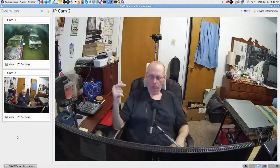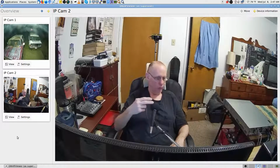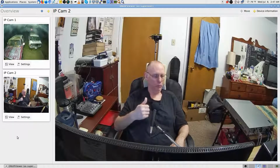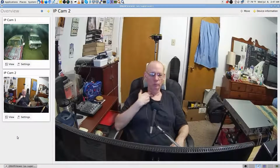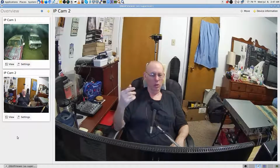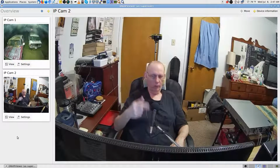But what I want to do first, I remember when I booted it up the first time or two with the VGA first in the BIOS and the video card second, it wasn't ramping up, the fans weren't ramping up and it wasn't making all that noise, I guess because the first device it saw was the onboard that it's used to seeing. And so it didn't think anything was wrong or see a device it didn't know how to handle. I don't care if I can get it to work right.